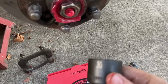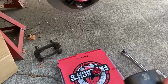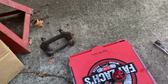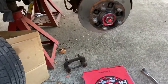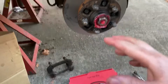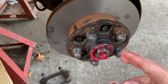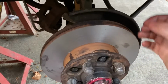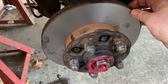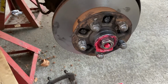What we're gonna do, we'll come over here with a 30 millimeter socket and run it in, and we gotta do the preload on the bearing. So if you got questions about that, go down there and comment below, let me know if I'm doing something wrong or if you got a better way of doing it. We can get dial indicators and tension springs like the book says, but we can go ahead and bottom it out and just back it up slightly, and we'll check for the feel and the play in the rotor if there's any movement. We don't want a lot, but just enough. So we got to get this seated correctly, then we'll get this nut put on.